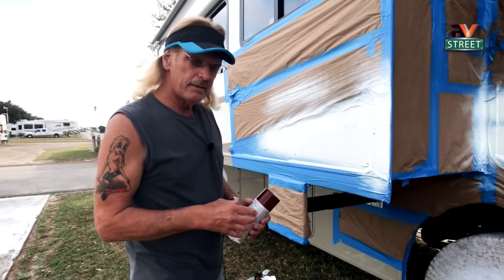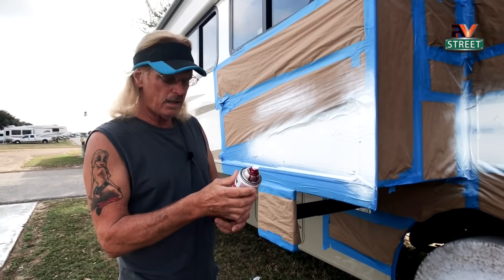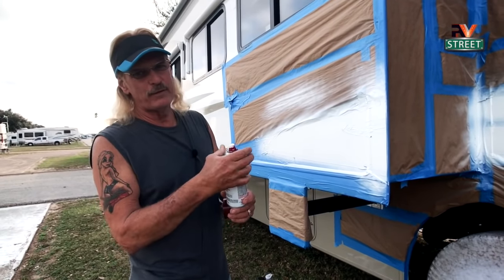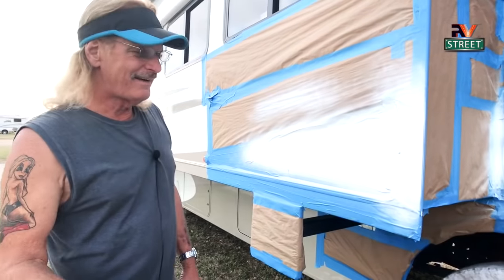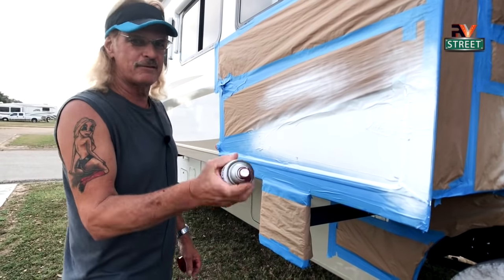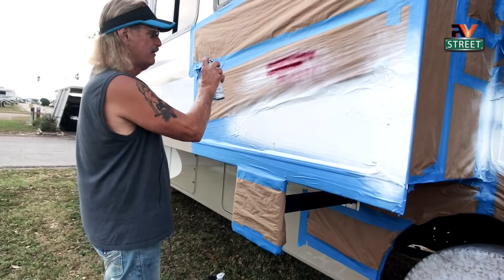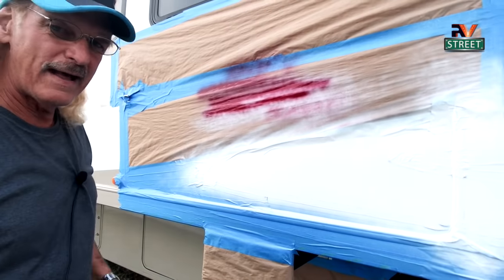If you remember, I told you earlier to try to get the paint cans with the trigger on the front. But this color — Rust-Oleum Gloss Burgundy — is incredibly close to matching the factory graphic color. It didn't come with a trigger, just a button-type applicator, which I really didn't like. So I bought two cans in case one starts to spit and spatter. As long as I stayed back about 10 to 12 inches, it gave a good fan. When you get close, the spray is narrow, but if you come back a little, it spreads open.